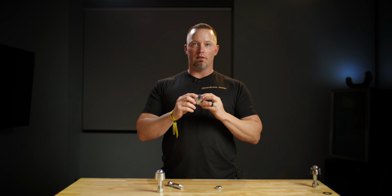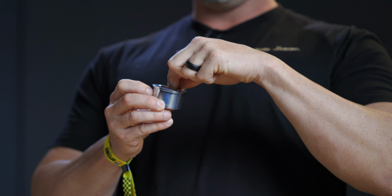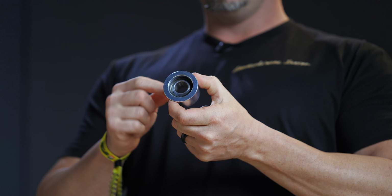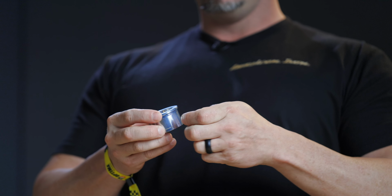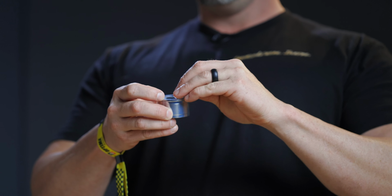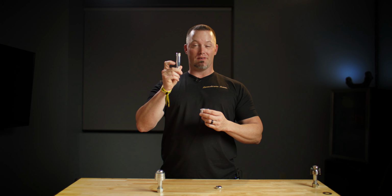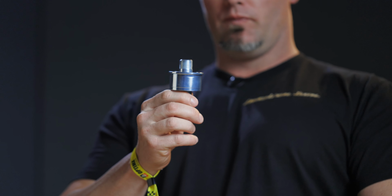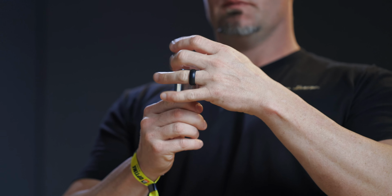One of the advantages of a delete system is once this cup's pressed into the axle, you can actually rebuild this assembly by not even pressing everything out. You literally remove the C-clip and remove the bearing. New bearing goes in and you reassemble with the C-clip, the seal, shim. You actually don't even have to remove the stud because it's already seated in the knuckle. You literally slide it right back up through and your rebuild kit comes with new nylocks.